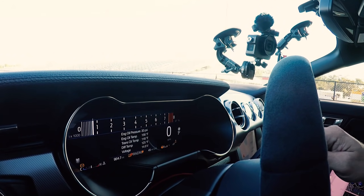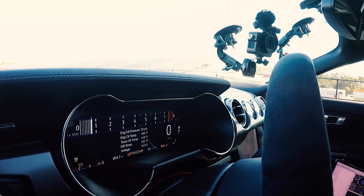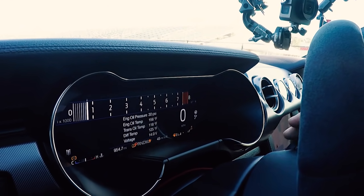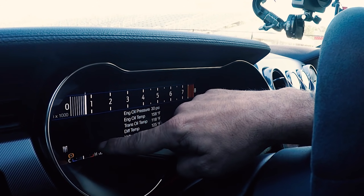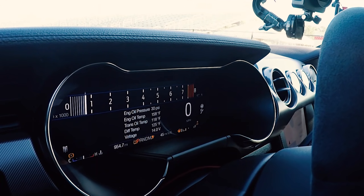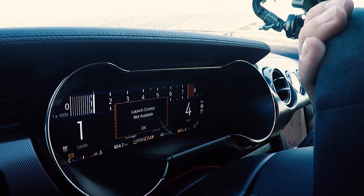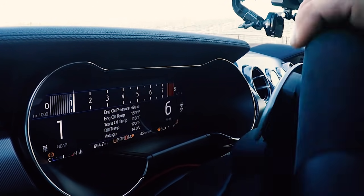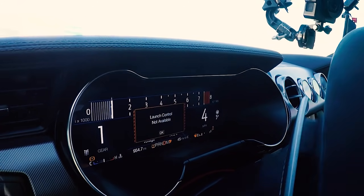Okay, let's talk about the lights on the dash real quick. We've got obviously the tire pressure light because we've only got 20 PSI in the tires, which is where we're going to start with these. The airbag light is on because the seat is unplugged. And this right here in the manual, I don't know if you can see it on the camera, there's a lightning bolt above the temperature gauge, and that's your emergency brake light, but it also seems to come on when the airbags are unplugged, and for a few other reasons that we have not determined yet.